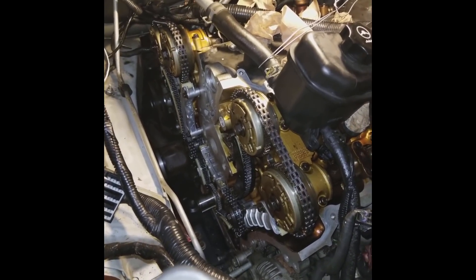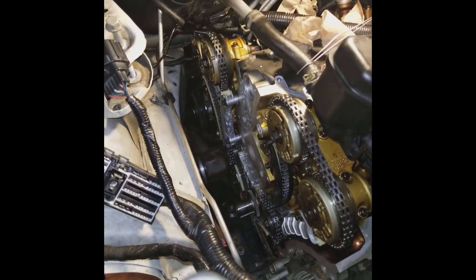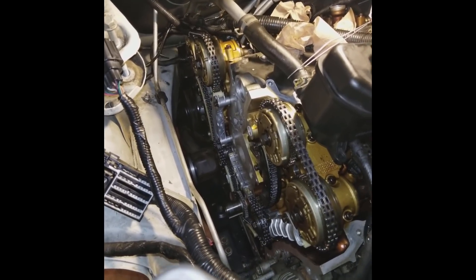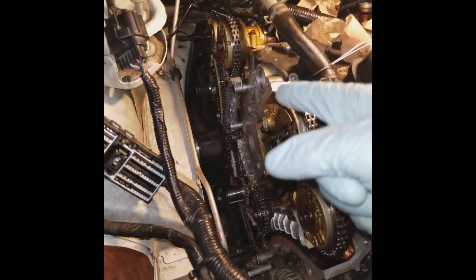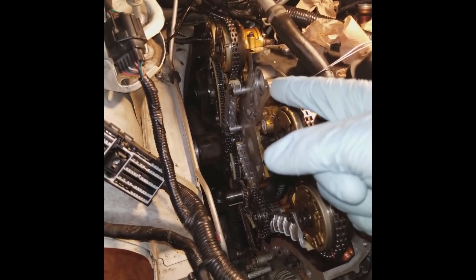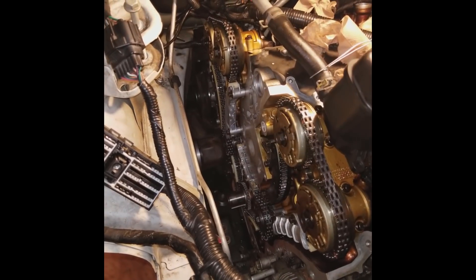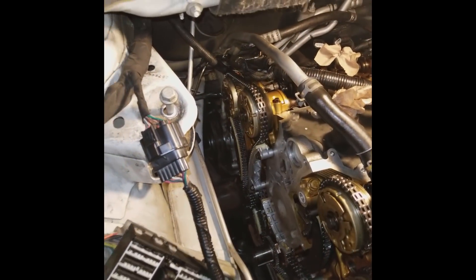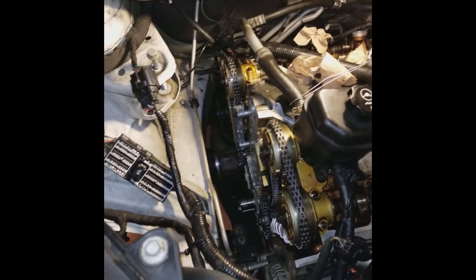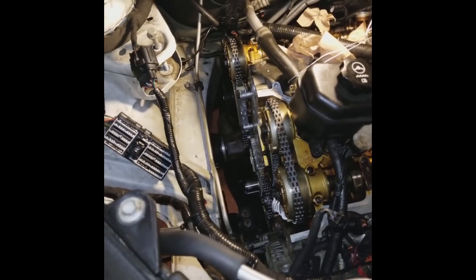This all started with setting correlation codes for crankshaft camshaft. I basically confirmed that the camshaft position sensors were working, and then tried replacing the variable valve timing or oil control valve solenoid — that's what controls the position of these actuators. At that point I knew it was a chain fault and that's when I decided I needed to put a chain in.